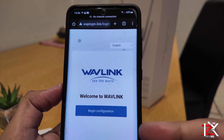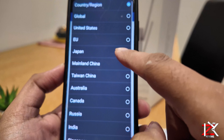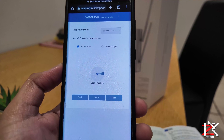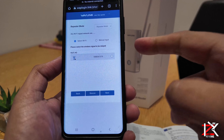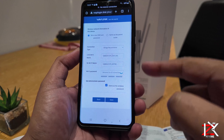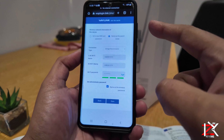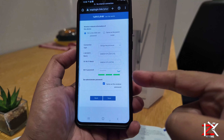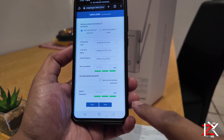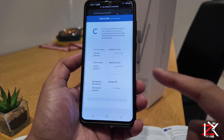Now go to your browser — this page should come up: login or register. Select your Wi-Fi signal and enter your Wi-Fi password. Leave it as bridge — recommended. You can leave the option to set a new SSID and password. Uncheck the set admin password option, and just make sure your admin password is different to your Wi-Fi password. Click save.